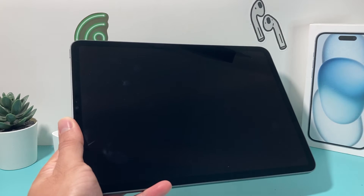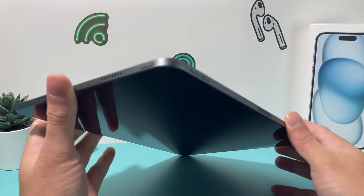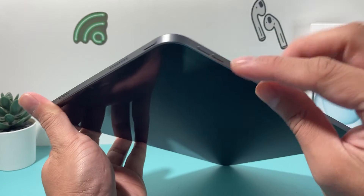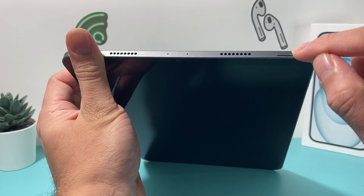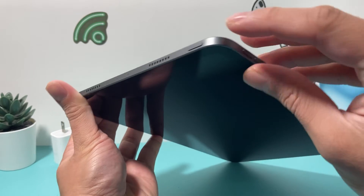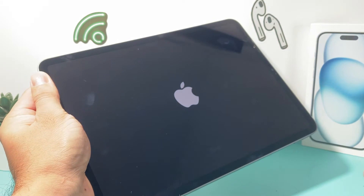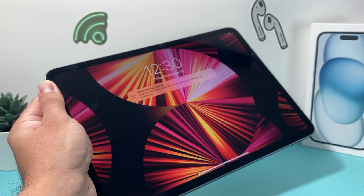The next thing is probably the easiest and simplest way to fix your iPad, and for most people this is what you need to do — it's called a force restart. It's a sequence of buttons. Locate your volume up and volume down buttons. Press and release volume up, press and release volume down, and finally hold the power button for about 20 to 30 seconds, even up to a minute, until you see the Apple logo. That will get the software to force itself to turn on if it's turned off for no reason. You need to do a force restart.